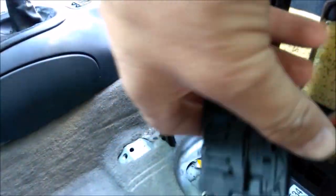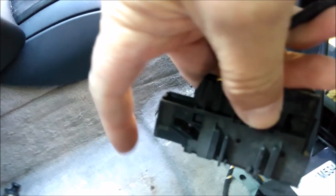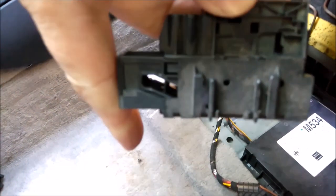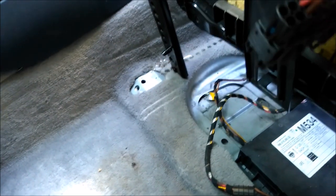That wasn't too bad. What you've got here is this kind of tower piece — you pull that out and the whole plug releases itself. It's difficult to do with one hand — you pull that out and the whole plug releases. I'll just show you again: you just pull that out, push that in like that, and it unplugs. So that is the passenger seat all disconnected.